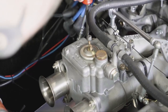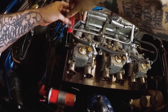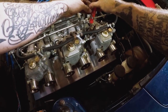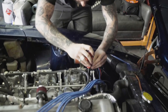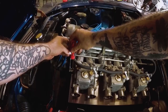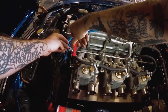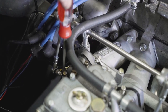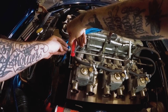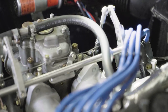Then you're also going to back out your idle speed screws until you see that the armature is disengaged. Now that this stuff is zeroed out, we're going to start setting up our idle speed screws. What you want to do is turn them until you see them engage — right where it engages, find it in the screw. From right where it's engaged, you give it a quarter turn on each one. That's basically where we want to start — what we've done is move the butterfly just behind the first progression hole.